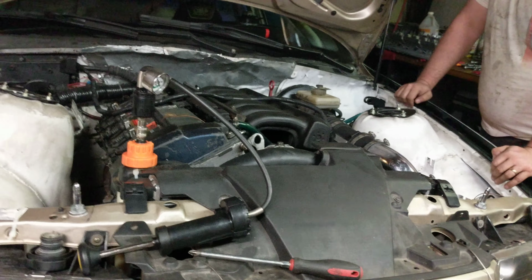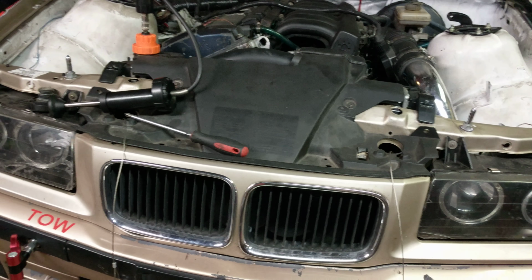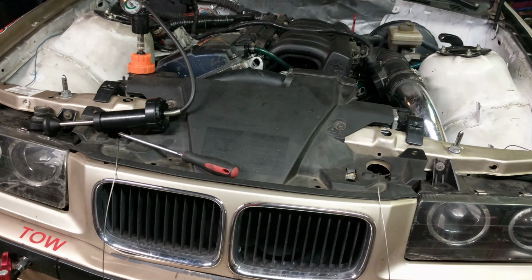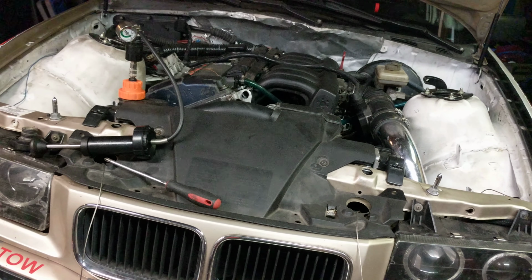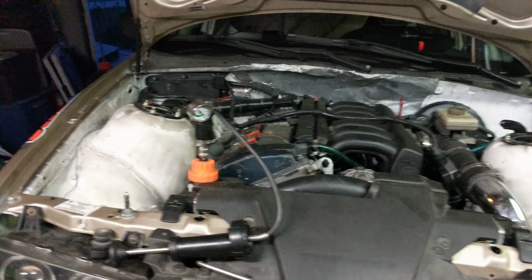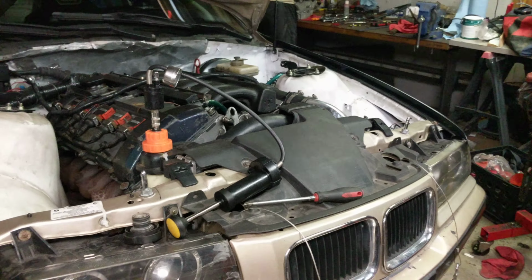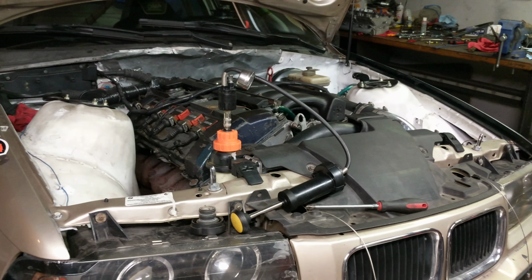We did install the factory air conditioning fan in. We were running fanless last year, but it's really hard if you have to pull a radiator to bleed it in the pits and know that it's good, because you've got to drive the car to stop it from overheating. Now we can just sit there and flip a switch and it will run that on high, and we can see how that works and make sure things are good before we send people out on track, because you get halfway around the track and it starts overheating.